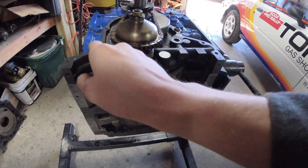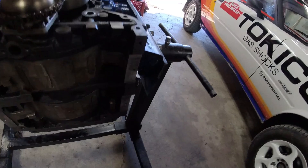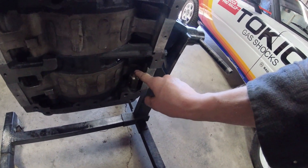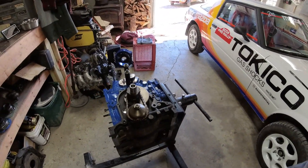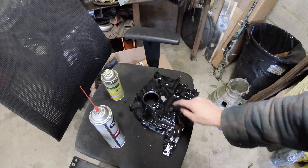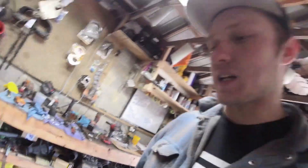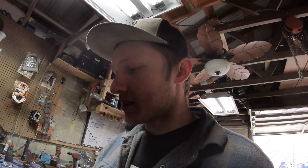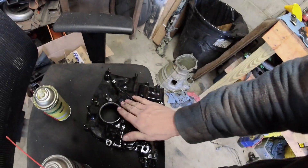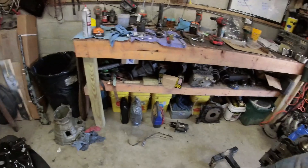On old-school engines I often don't run a front cover gasket — just RTV silicone the front cover to the front iron, which puts more pressure on that o-ring so it doesn't leak. Now, we've got the oil pump on and gears on. You can't put the hub on until you put the front cover on. I tend to smear the gasket with RTV on both sides so it sticks and helps keep oil from seeping through. Don't forget your oil pressure regulator down here. The front cover's ready to go — a bit irked that my paint job is coming off, so I'll re-scuff and touch it up.